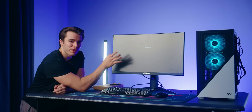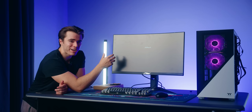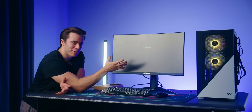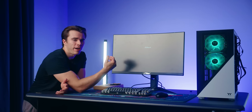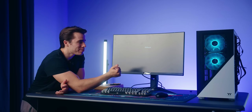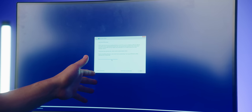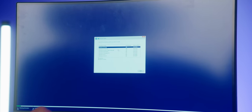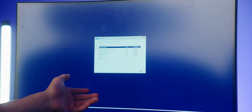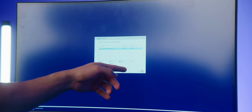We have the motherboard manufacturer name on screen. After about two minutes, the computer did a few cycles and the monitor flashed on and off — don't worry, the computer is just waking up for the first time. You should see a circle indicating we're about to install Windows. Hit next, install now, enter your Windows product key or click 'I don't have a product key' to change it later. Choose Windows 11 Home, accept, next, custom, select the drive, next.